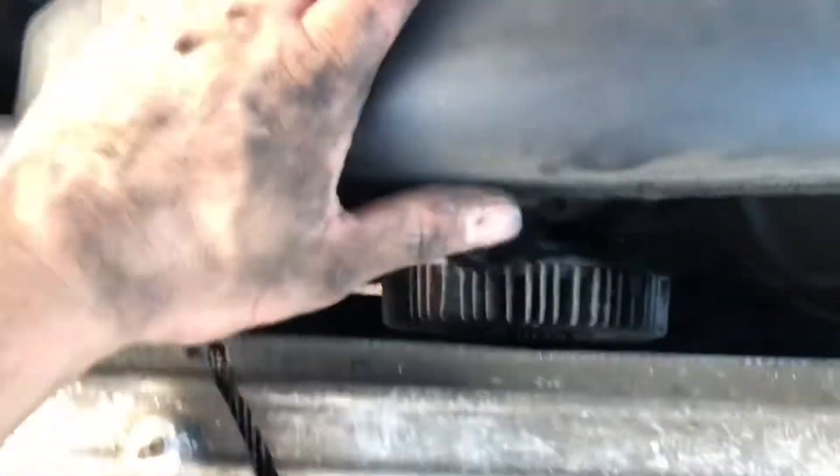I've pulled the two bolts out of this side, which allowed that to unbolt. I pulled the coolant bottle out, then undid the two bolts I could reach there. Then you've got to lift the fan shroud — the black plastic piece — up so you can get it unclamped. Get it out of that holder and out of the other holder, and push it back and out of the way.